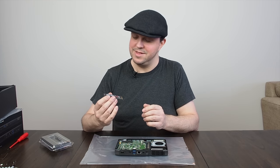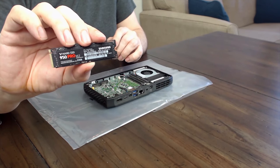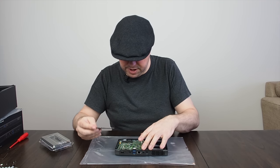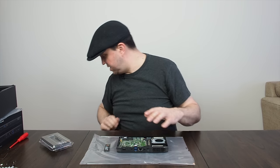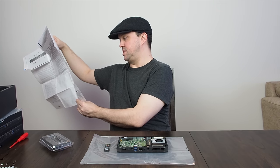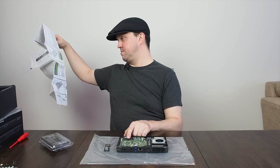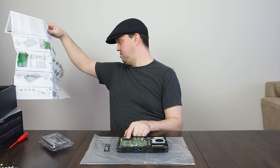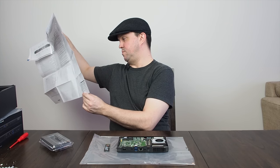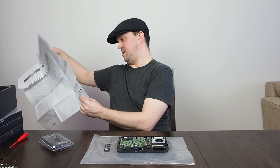Let's have a quick check on the sheet here. It's a single 80mm drive and it should go in slot M.2 A, which is this one here — this is A, this is B. Actually, apparently you can put it in both; no mention is made as to whether it's optimal in one versus the other. In that case it's going in slot A.